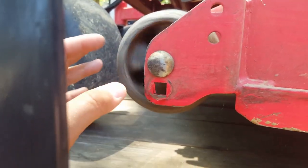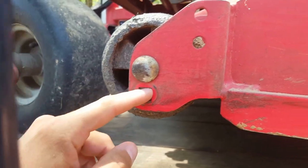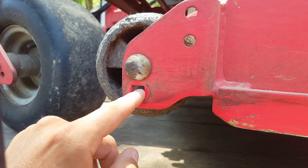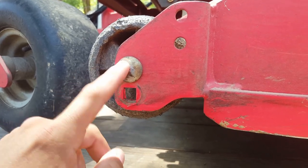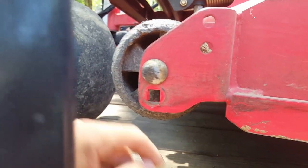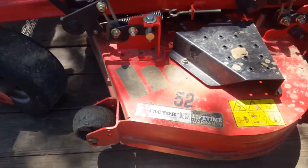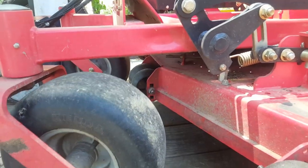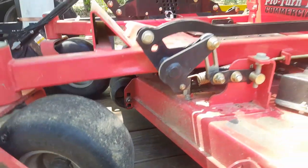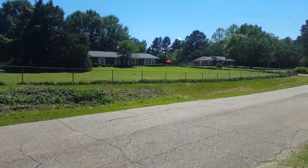So that's why: if you cut anything under three inches you're going to want to go to the upper hole. If you're three inches and up, you're probably safe in the bottom hole. But if you're cutting a lot of yards at three inches, you're probably still better off in the upper hole. I personally like to keep it a quarter inch under the deck. I've got a 52-inch deck so it doesn't scalp bad anyway, but be careful. Also remember you've got center wheels too — remember to move those.